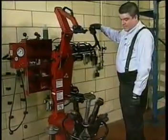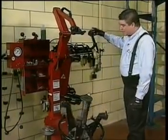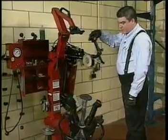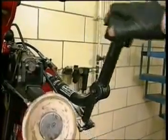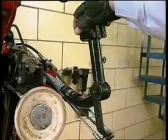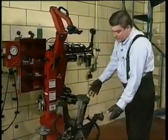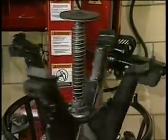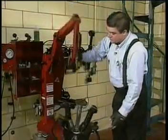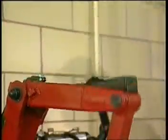Let's review basically the 3 major features that make this machine unique for today's sophisticated tires and rims. We have a bead roller assembly here that allows us to push and pull and mount and demount on the tire. As we're using that, we can put high forces. This eliminates the need for the side-mounted shovel, but as we're pushing, the wheel is clamped with this tulip system with rubber. If the wheel is moving, there's no damage to the rim, and in order to protect the rim while mounting and demounting, we also use this polymer mount head and the articulating arm, which follows the rim as we're servicing the tire.